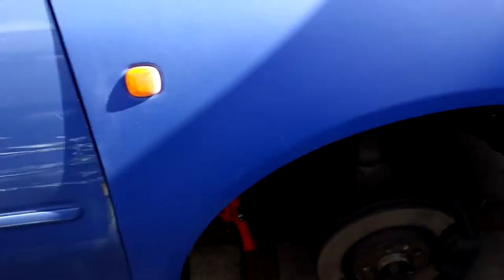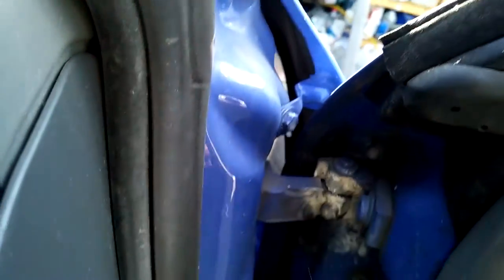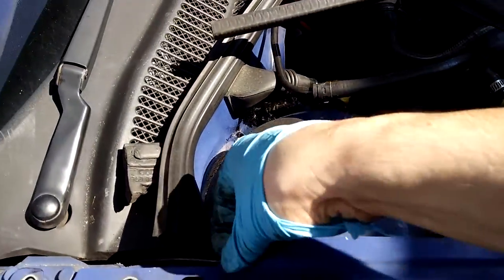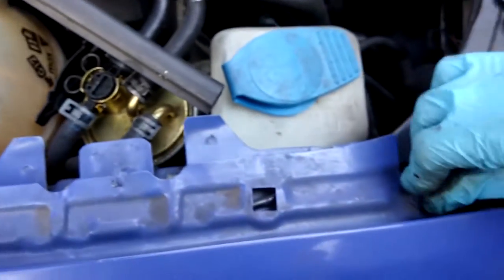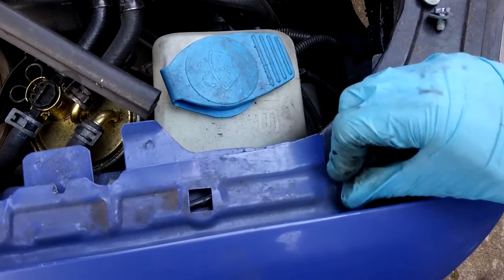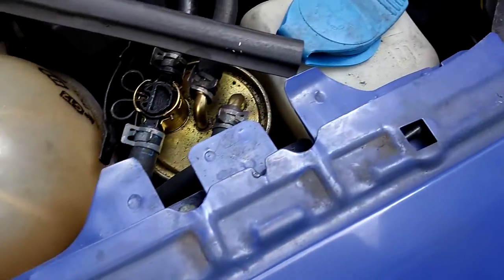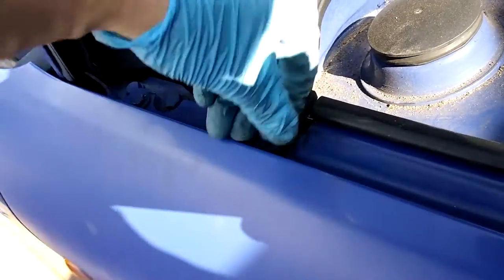I've put the new wing on — that wasn't too easy to capture — but I've loosely done up all the bolts to give myself some room to manoeuvre so I can make sure all the gaps around the wing are perfect and it fits the way I want. We've got the two bolts underneath, the bolt inside the door, and the four bolts on top. You've also got the bonnet release cable — make sure you get that lined up. There's a little foam padding that fits underneath the wing; if you can get that lined up in the right place, great. We're going to fit the four bolts back in and put that foam pad back on as well — it fits right into that groove.